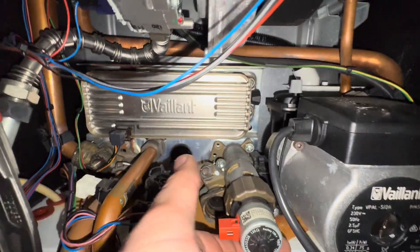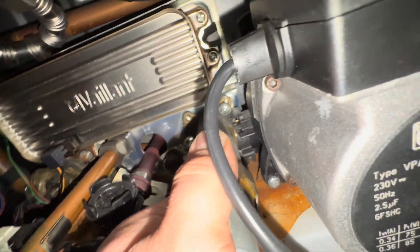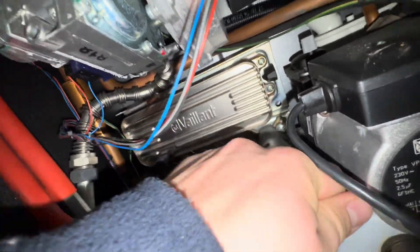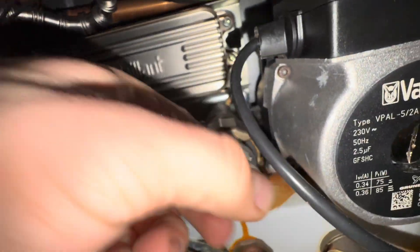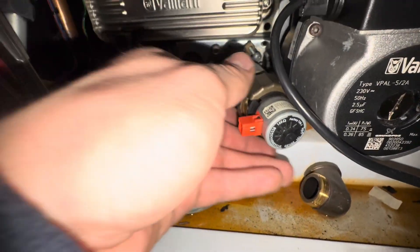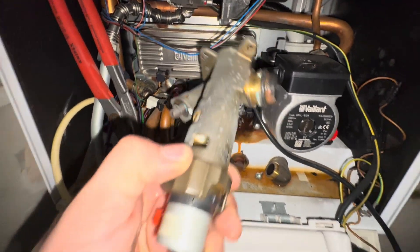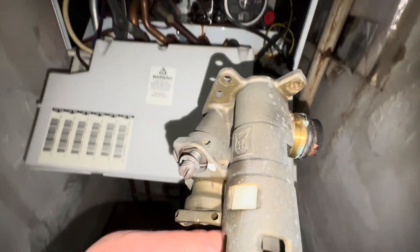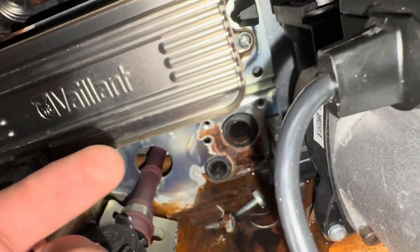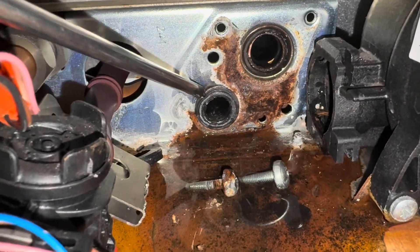All three screws are done. The way this valve comes out is you wiggle it and move it to the left to pop it out of that section. There's still going to be a little bit of water in there so catch that — a little bit of water, it's fine, we'll deal with that. Pull it out, and that's it — that's your valve out. I'm just going to be doing everything in reverse now. Get rid of these two washers.